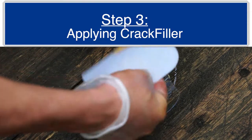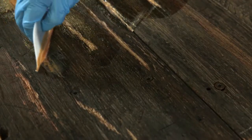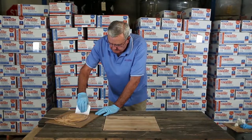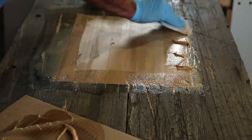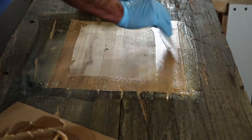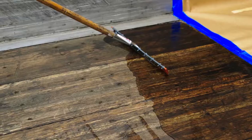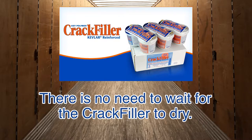Step 3: Apply the Crack Filler. Use the application blade to push Crack Filler into gaps, gouges, and holes. Don't spread the Crack Filler too widely beyond the repair area — any excess can be easily cleaned up using a commercially available solvent before it cures. For heavily damaged floors that require sectioning, Crack Filler is ideal for sealing the gap between the existing floor and the new section. Forcing Crack Filler into the gap will complete the sectioning repair; when it cures, it will effectively seal the new and old floors, forming an impenetrable bond between them. If the trailer floor is being prepared for complete restoration using Key Polymer Floor Restore, you can proceed immediately with the Floor Restore application — there is no need to wait for the Crack Filler to dry.